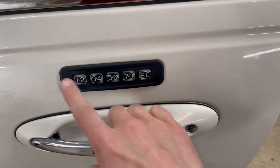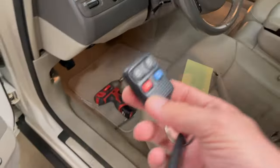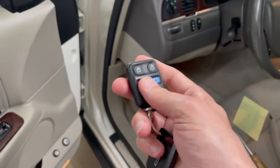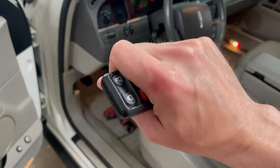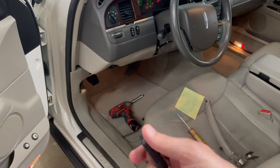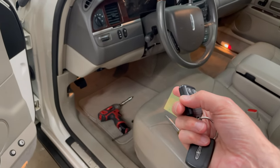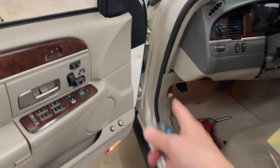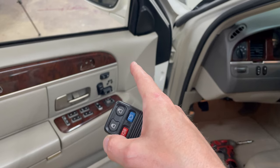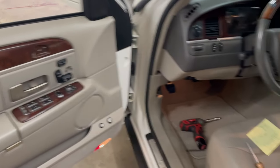The only other things to check are whether the exterior keypad works — I don't have the code for that yet, I'll come back to it — and the key fobs. The fob shouldn't work right now because the key fob actually gets programmed to the DDM. Here's the easy trick: put the ignition key in, turn it on and off — on the eighth time you turn it on, you have to do that within 10 seconds — leave it on, and the door locks will activate. Hit one button on the remote, and the locks will go up and down to indicate it was programmed. If you have a second remote, press it within a few seconds. That programs the remotes to the DDM. Also note: there's no VIN associated with that DDM, which is a nice thing. But if you take it to the dealer it'll be a really expensive repair, so I'd recommend trying this route first.